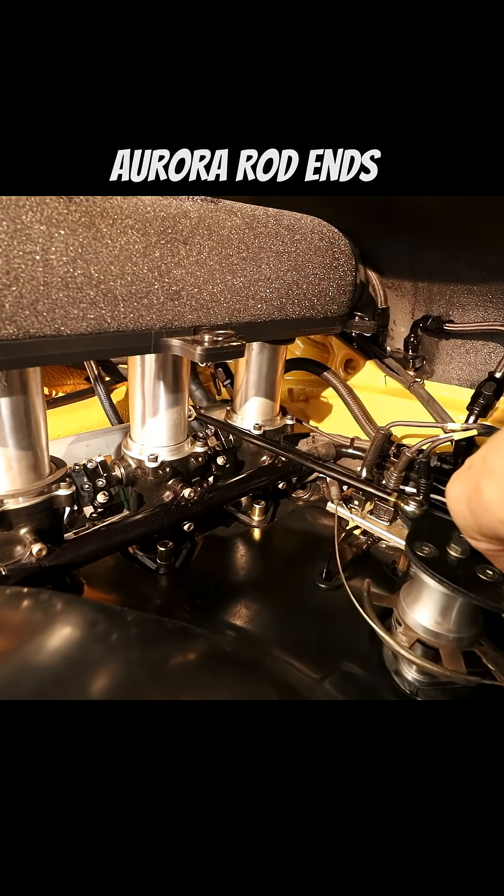Synchronization on this engine so far has been great. The other nice thing about drive-by-wire is it offers things like launch control, but on this car it's a vintage hot rod — I don't think launch control is needed. Emtron does have something called torque management, so if you want to reduce the power in first gear you can, but wheel spin in a car like this with a rear engine is not really a problem.